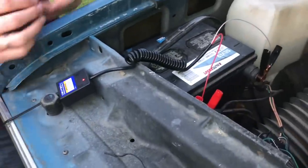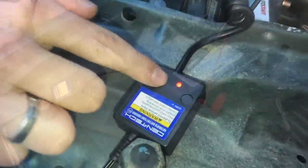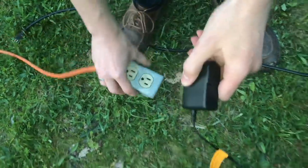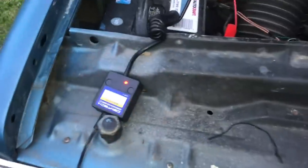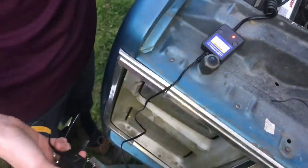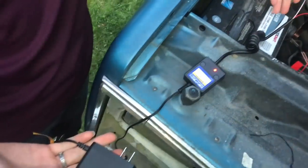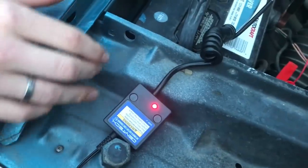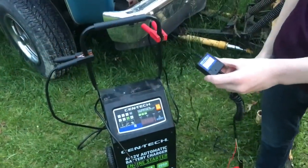With this big charger you have to bring it in every night, so this is a bit more convenient if you don't have a time schedule. This LED doesn't mean that it's actually hooked up to power — if I unplug this, you can see this LED will stay on. It's just taking power from the battery. Just because the LED is on, that doesn't mean it's connected to power and charging your battery.